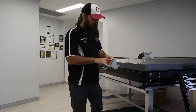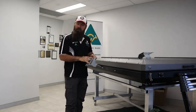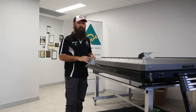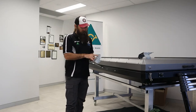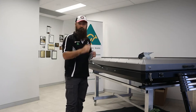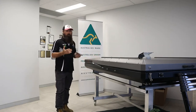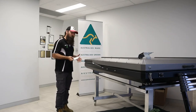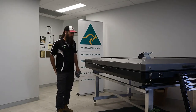The only other difference with these is we've increased the size of the hole centers for the rear of the awning. Some of these awnings these days are very big, so we've got a rear center with this slot where you can get up to 120mm of purchase on that — that's quite large. It should cover most of your 270s or any of your really large awnings. Just check with your manufacturer of your awning prior, or measure it before you drill, to make sure it's going to work.